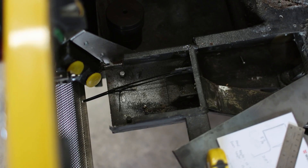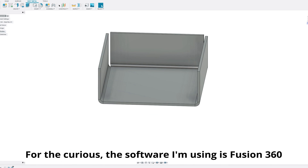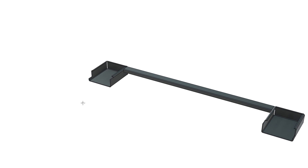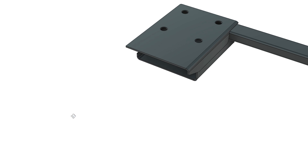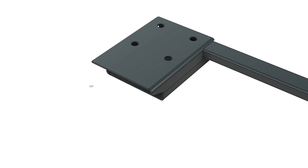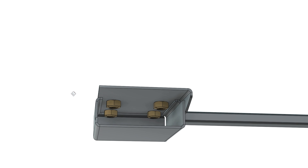Back to the back of the car for a second — let's talk about this pedestal box. We need to draw it up in CAD so that we know what we're trying to build. I don't need it to be absolutely perfectly accurate, but the measurements I took will get us close enough. Here's a pretty close rendition of the framework in the back of the car that we're going to be mounting to. The first step is to cap this box off with some plate steel that extends past the rear bound of the box, and fold it over the side for more support and more surface area to weld. You can see the finished product with four holes drilled into the top. Before we weld this panel down, I'm going to weld four captive nuts to the back side of it to make installation of the wing uprights nice and easy.